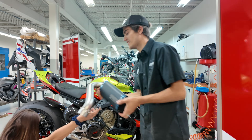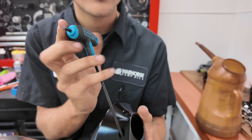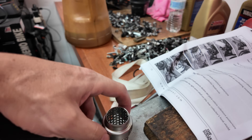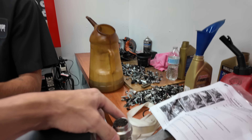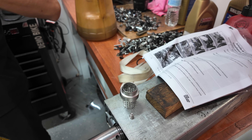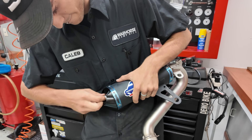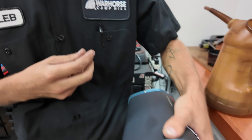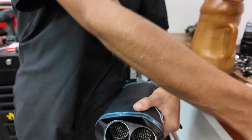This is the reason why you remove baffles off the bike — because those screws can fall. It's weird that something this small would make such a big difference in the sound. What I've found from leaving baffles in versus having them out is that when they're in it makes it higher pitched and kind of squeezes the sound. When you take them out it actually makes the sound lower and, in my opinion, sounding much better. There it is — that's how easy that is. Looks like there are two chambers inside.